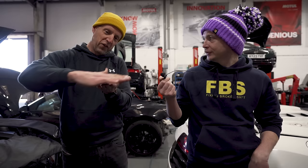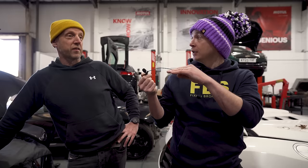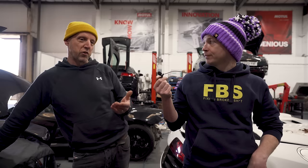They have a real problem overheating the front tyres, so you've got aerodynamics creating downforce on one side and front tyre cooling on the other — somewhere in the middle is the compromise. Aprilia's rear subframe is really intuitive — they've got a big kicker in front of the wheel that sends air up over the tyre. Dorna forced them to run a pitot tube matrix to get an understanding of the airflow — there's only so much you can calculate on a computer.